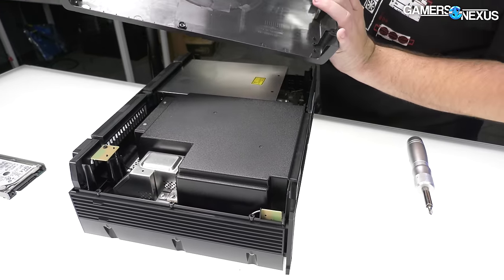That's it for the teardown of the PS4 Pro dev kit. The most interesting aspects are: double the memory capacity of what we expected versus the consumer model, a pretty interesting cooler design for the SoC, poor memory cooling that's probably sufficient for a dev kit's purposes, and an overall design that we think was an inspiration for what led to the PS5's thermal solution. Thanks for watching — subscribe for more content where we take apart unique things like this. You can also go to store.gamersnexus.net to help us out directly.